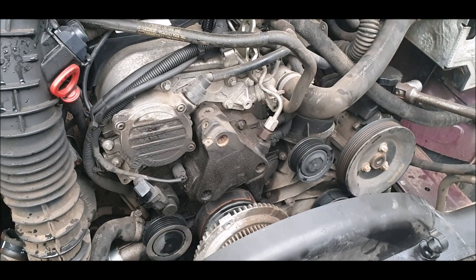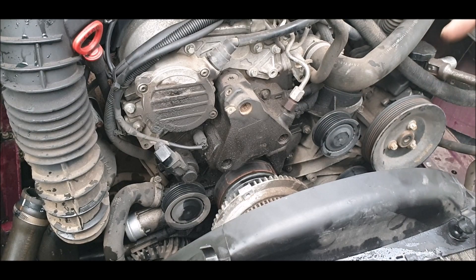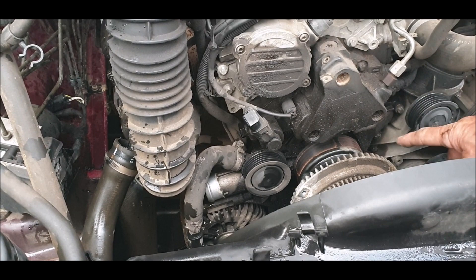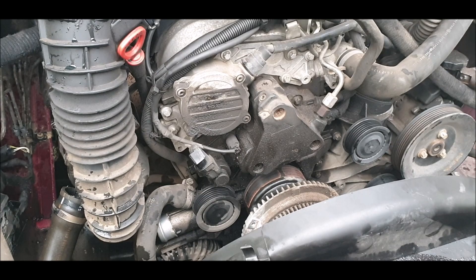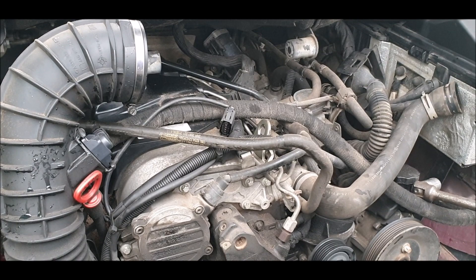I'm doing it a bit at a time — this is an 8mm star and I haven't got one, so I'm just going to get one tomorrow. It's got the viscous fan connected to it, which is okay. It's leaking at the back and it's got one pulley. But all this has to come off for that. So of course you have to take your induction unit off, your air filter — it's pretty straightforward, it just fits onto these rubbers. So it's not that bad.